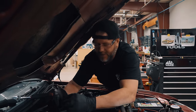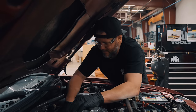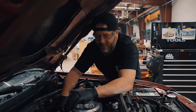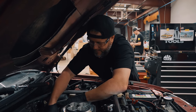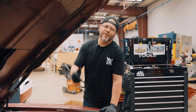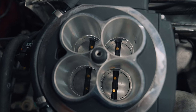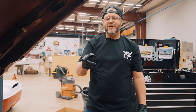Now I'm working on the throttle cable bracket — had to make some modifications, move it back a little bit. The throttle cable was coming out a little too long for the Sniper. It was kind of too long for the carb too, something I'd been needing to do. Definitely have to make sure we get 100% throttle pull on the Sniper — very important, you gotta have full throttle. I got the throttle cable hooked up. If you shoot down the barrel of the throttle body, you can see the butterflies. I'm going to press the throttle pedal and verify that they open all the way.